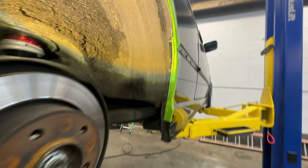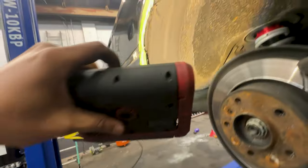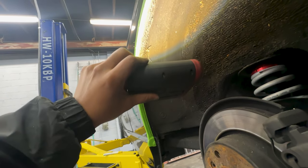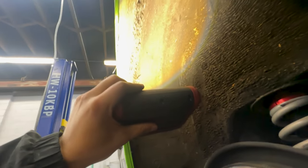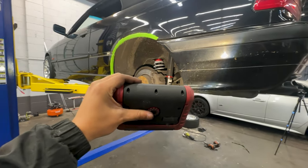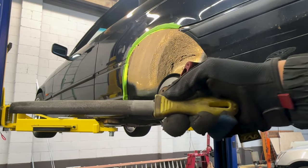Okay, one eternity later — we cut the whole lip, it's gone. As you can see, this is on the passenger side and now we're going to go to the driver's side. This is actually the first time I've ever done something like this — trimming the whole inner part of the fender. I stayed on the line, and now it's just a matter of making sure this is nice and smooth. I'll take the fender roller to smooth this out and then use a round file right here, and I should be able to fit the wheel back on.